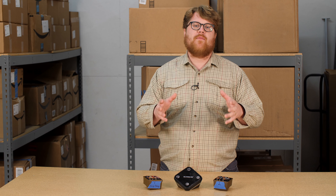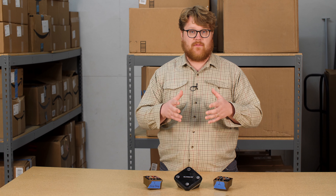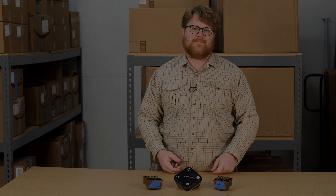I'm now ready to start over and pair these two sensors correctly. We went through the steps to pair two sensors to one receiver on different zones, and how to change the melody for a sensor already paired. We also covered a common troubleshooting error: why won't the second sensor pair to a different zone? Double check — did that sensor get paired to the first zone during pairing? We talked about how to reset that zone so the system can be repaired. You cannot pair a sensor to a zone if it's already paired to a different zone. We hope these videos are informative. Please leave comments, give us a call, or visit our troubleshooting guides online. I'm Simon with GuardLine — thank you for watching.